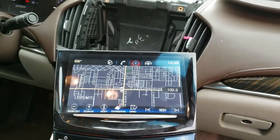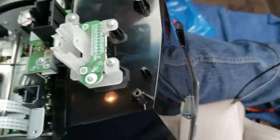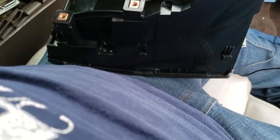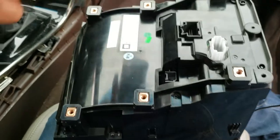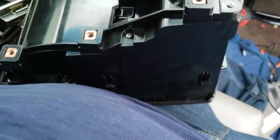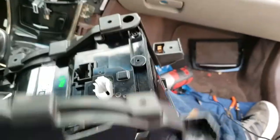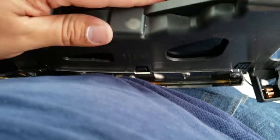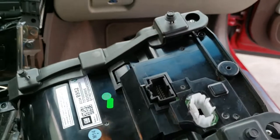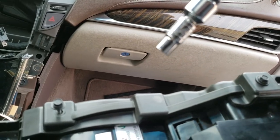We've got to put everything back together now. Once we have all the screws back into place securing the top layer with the bottom layer, go ahead and insert the cover for the rear and put in all the screws that go all around the base. Once you have the whole cover back into place, attach the side trims — they simply go on each side and take four screws. Drive them in with a 7mm socket.